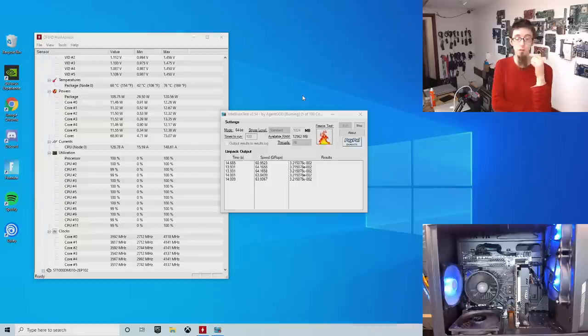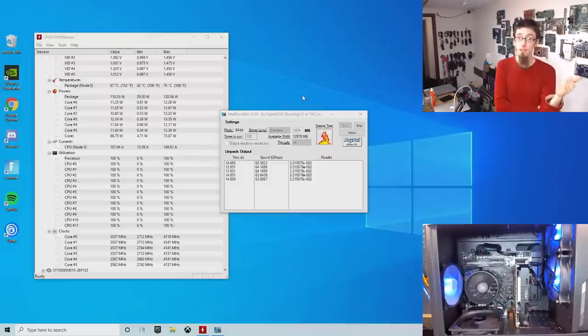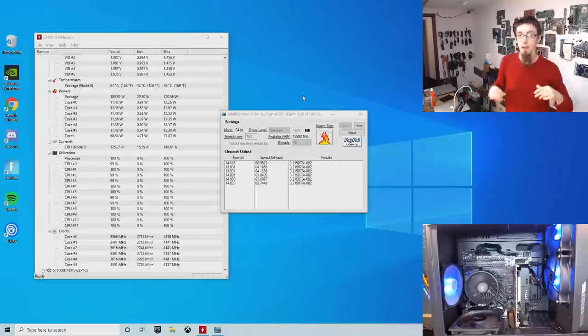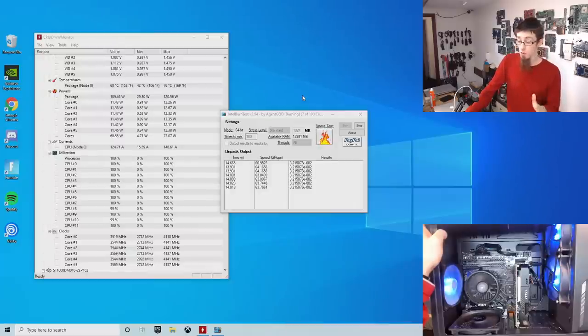Another way of solving this would be to manually dial in memory timings. I have a video on this. I can't remember what it's titled, but if you search my channel for XMP, it'll come up. In that video, I demonstrate XMP causing issues, ironically with a Gigabyte motherboard again, and how you can use a utility, I've forgotten the name of the program, to manually generate some safe XMP timing settings that are almost guaranteed to work and are just a little bit more fettled than the XMP profile. It's an absolute ball ache to do. However, if you've got no other options, that will probably make XMP work on a system that otherwise will not.